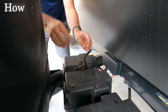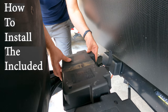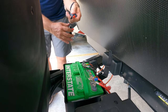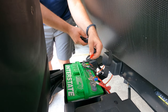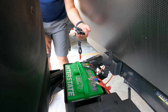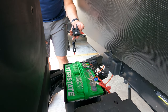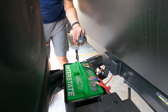It is blazing hot out here in Florida today, so I am not going to crawl under this trailer and do the full install of the repeater, but let me show you how it gets installed because it is super simple. All you have to do is take the cover off of your battery system, then attach the simply marked red positive and black negative alligator clips onto the wires, and then run this repeater back along the chassis. Be sure to fasten the wire so it's not hanging down and won't get caught on anything. This way it'll amplify the signal from the vehicle or wheels you're towing, which are pretty far back from your receiver in your cab, and you'll always have a strong reading of your tire pressure and temperatures.